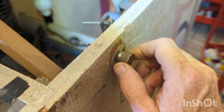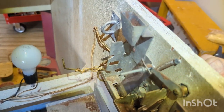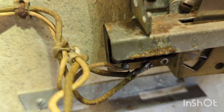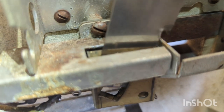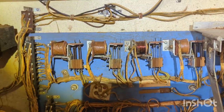There's a little clever thing somebody added probably quite some time ago. This is a credit switch. I first thought it was some kind of eject mechanism - right next to the coin mech - maybe it was originally, but it's not anymore. You can see that turns that little metal plate there. You can probably hear that credit switch clicking. Somebody had to dig that out. It also keeps you from pressing that switch too far. See, they cut out that little piece and it keeps you from pressing that switch farther than it ought to go. Pretty clever. I'll keep that - it's not quite original, but once it's 40 years old, we can kind of call it original.